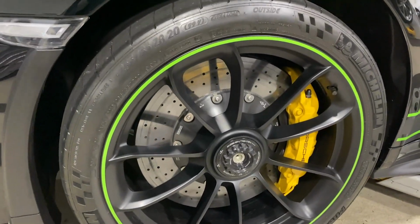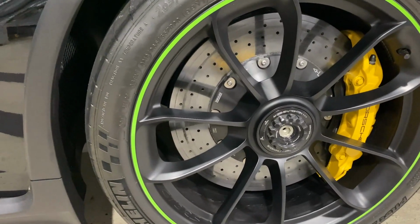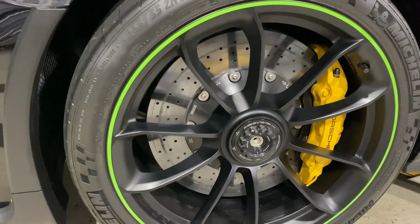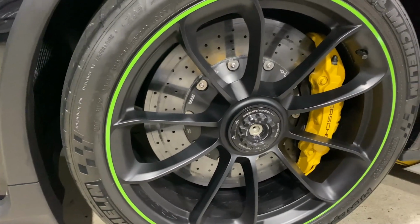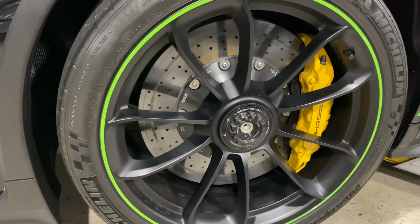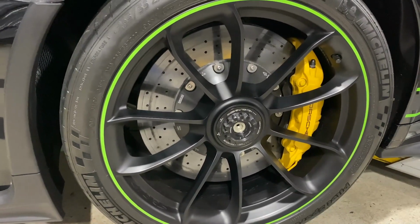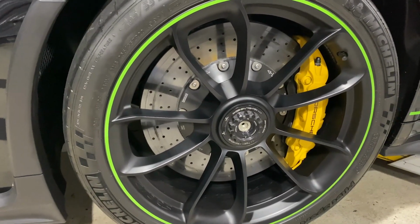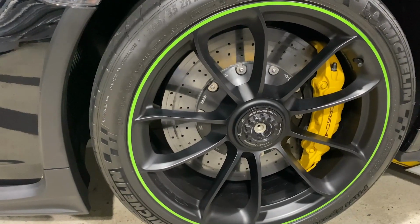The rotors, we're not checking here, because for the ceramic rotors, it's quite an involved process. Yes, it's a density test. A density test. And what is it using? It's infrared, I believe. Oh, infrared. That shoots the disc, because for the ceramics, it's a matter of how much carbon is on the rotor. The carbon count, I guess. Yeah. So we're not going to do that today.